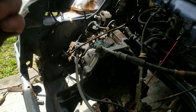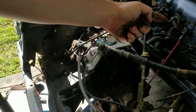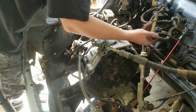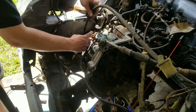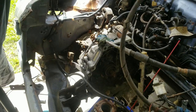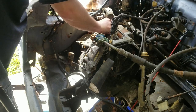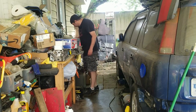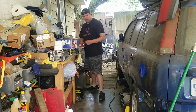All right, let's get the transmission removed. Looks like we just got a couple bolts — there's one in the back and then the side one over here. All right, the back one came out pretty easy. We need to disconnect the clutch cable — and that is done. Now we've got the starter wire. We need to get a tool for that; I believe it's a 12 mil. I can find one — there's a 12 mil.